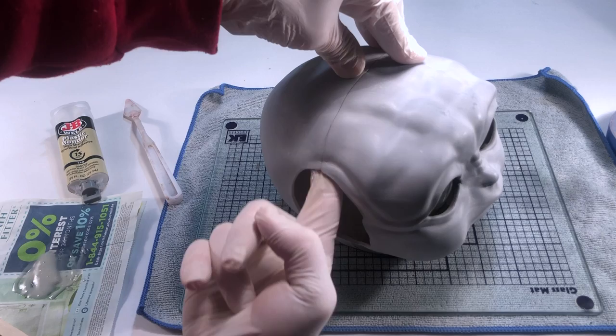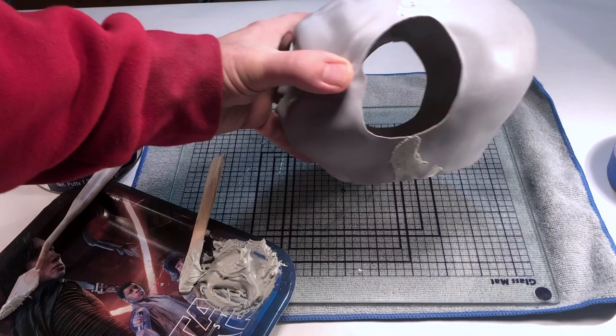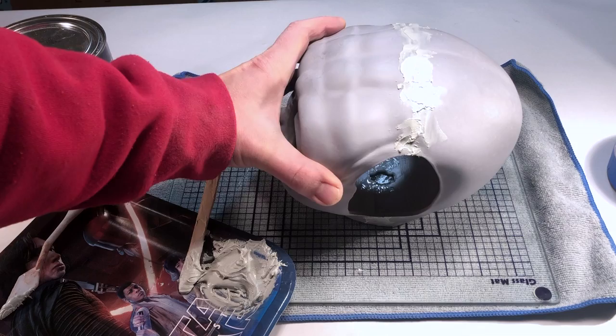If you still have a ridge in the middle of the head, use your choice of filler. I was anxious to keep moving on the project, so I used some quick curing Bondo filler. Wood filler putty can also be used, but a longer dry time is needed.